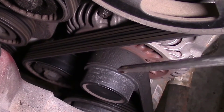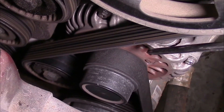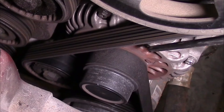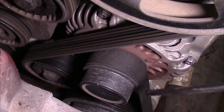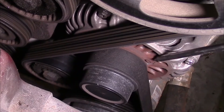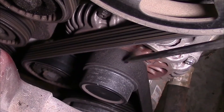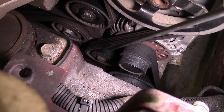Now I want you to inspect the front of this alternator — here's the alternator pulley right here. If you look back, you see this orange color, this rust. That rust is actually metal filings or particles from the bearing. As it gets thrown out, it accumulates here and starts turning rust. That means for sure the alternator is bad and we're going to have to replace it because the bearing failed. We've got three other pulleys we need to check.